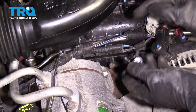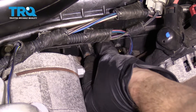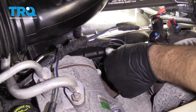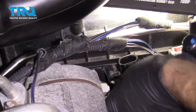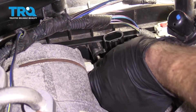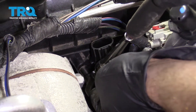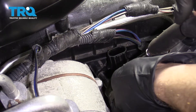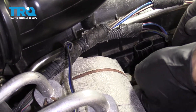There it is. Take your new sensor — if you want to put a little bit of lubricant along the seal, it's up to you. I always like to. We're just going to press this in there. It should want to go in. Slid right in — easy peasy. Love it. I'm going to grab that screw and try getting it back in there. Hardest part is getting my hand in here. Just going to get it to stay on there — that's pretty much bottomed out.